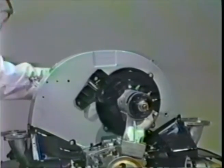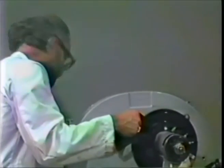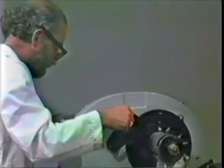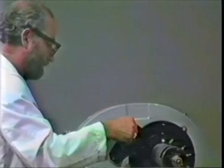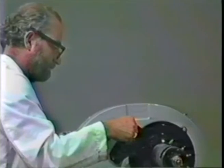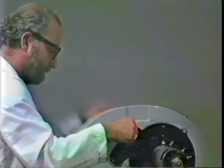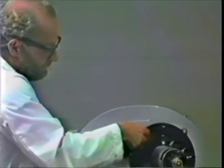Get out some nice new 6mm bolts. Get out another washer that just fell off. Replace the one that fell off. Transfer. Put on your bracket. It goes on like that. You can slop around a little bit right now, but when we tighten it down, it should be facing upwards. That supports the fuel line, and you need support because it has a flexible piece in the middle.